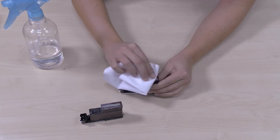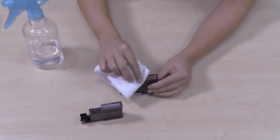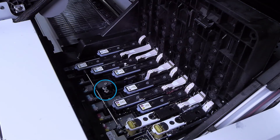Place a cloth below the needle to prevent ink droplets from falling on top of the carriage. Check the bottoms of the white print heads — if you see any ink, clean them gently with a lint-free cloth dampened with distilled water. The FI Tower (B) is the structure into which the print head (A) is inserted and through which ink arrives at the print head. Whenever you remove a print head, check whether the FI Tower has a lot of ink on it; if so, clean it with a lint-free cloth before inserting a new print head.